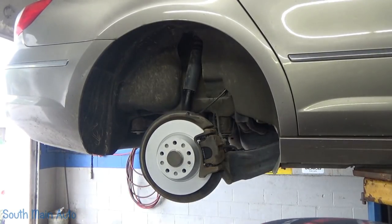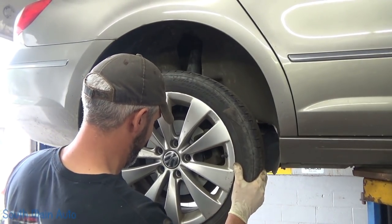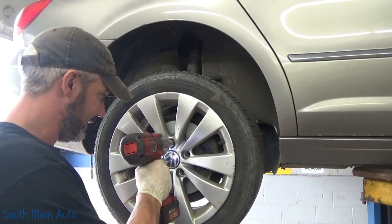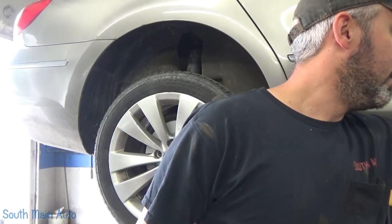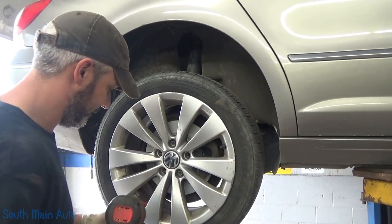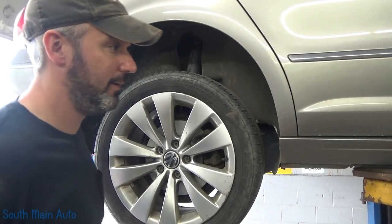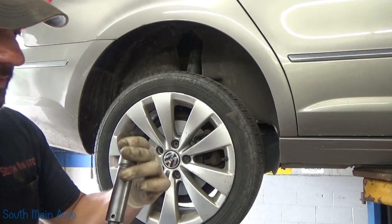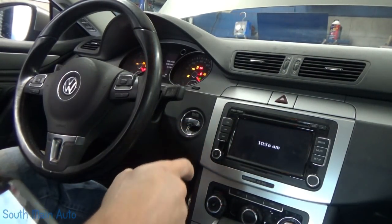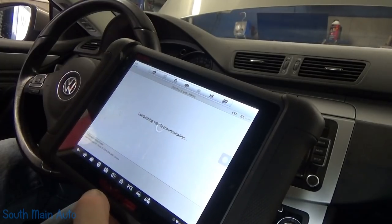And that's pretty well that. Make sure you do both sides. Don't forget to plug it back in. Get the tire back up on there — I hate these Euro cars, it's a little bit of a balancing act. Once you get one stud in it's not too bad. We'll get the rest in and torque them down. Respect your specs — which I think is about 88 foot-pounds on these. Turn the key back on now. It is exiting service position, so it should be making a bunch of racket here shortly.